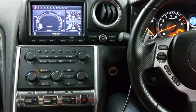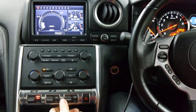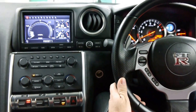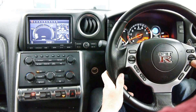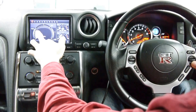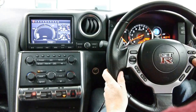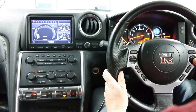We select drive, TCM into race mode. We have configured it so that we can run this car with traction control off and foot on the brake, and we're going to go into launch mode. You will see that we're in launch mode because of how quickly the manifold pressure will shoot up and then control the RPM at around 4000 RPM. Full throttle — that's launch control enabled.